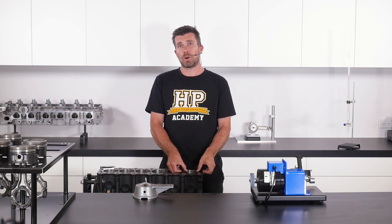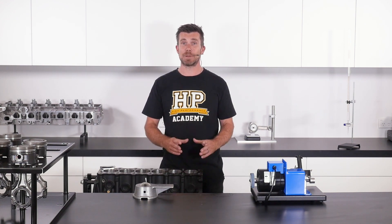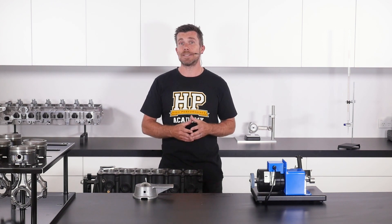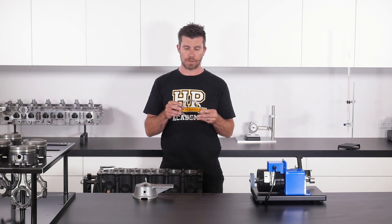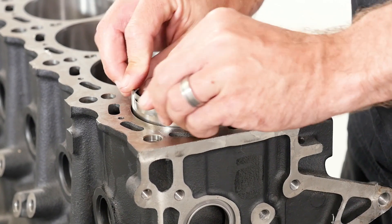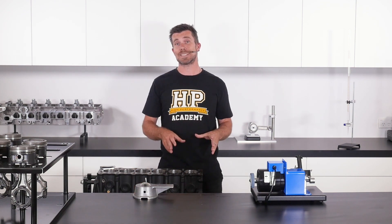Now we've got our ring located in the top of the bore, but this isn't where we want to make our measurement. We want to move the ring slightly down the bore and ensure that the piston ring is square in the bore before we take our measurement — if the ring is slightly offset, this will make a big difference to the ring end gap. I've got a relatively cheap tool here for squaring the piston ring in the bore, which suits a variety of bore diameters. We rotate it and lock it down to fit our specific bore diameter, then push down on top of the piston ring. There are little sleeves that stick out and locate on the deck surface of the block, ensuring the ring is the correct distance down from the deck surface.